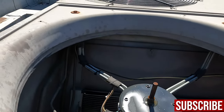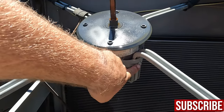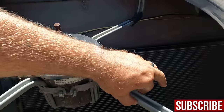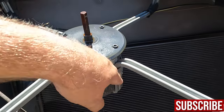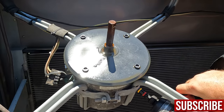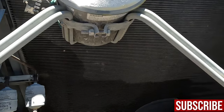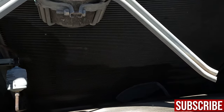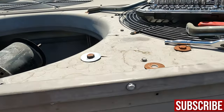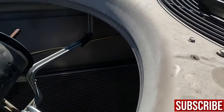Work the shaft back and forth and get it off. Next step - we got a 5/16 screwed in here. Let's get the rest of this bracket off and we'll have to loosen up the motor just to get that off. Don't want to drop that down into the abyss. Still got to get that fan blade out. New washer, bolts back in - that's back in, I need to tighten that now.